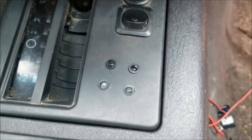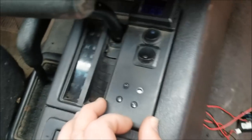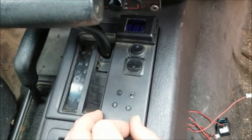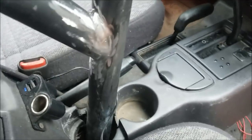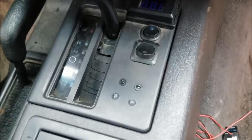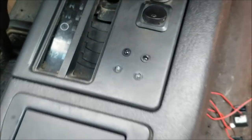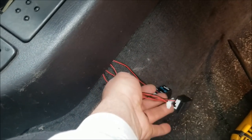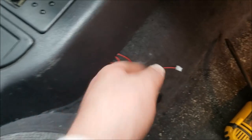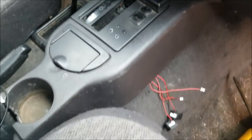We can see we have all four LEDs installed. My installation is probably not as straight or as clean as it could be, but this is a purpose-built vehicle, so it really doesn't matter. Anyway, it's just a quarter-inch drill bit — drill your holes, pop your black trim rings in, pop your LEDs up through, get your connections made, plug them into the box. I'm gonna go ahead and make all these connections here and get them connected to my six-pin wires, then just get them plugged in back at the amps.